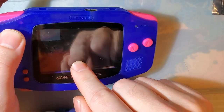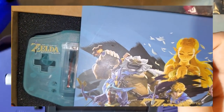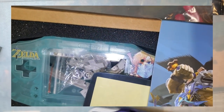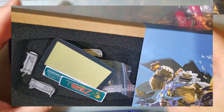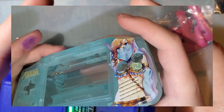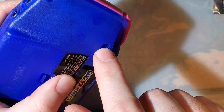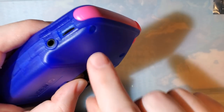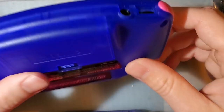Trimming is very easy for a stock-style screen — there are just little notches you clip off with flush cutters. It is there and it does require modding if you don't want to use an IPS display. But if you're using a stock display, just use a stock shell. There's nothing wrong with stock shells, and you can still get regular aftermarket shells designed for stock screens. One thing I did notice while putting this together — I did use the included screws. I think it's nice that they include screws, but you should reuse your original stock screws.